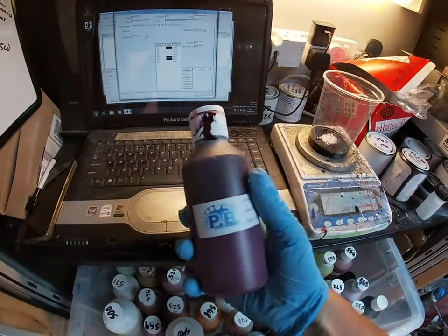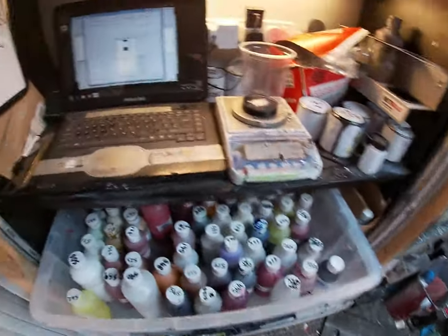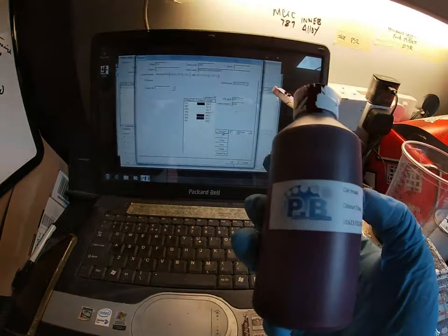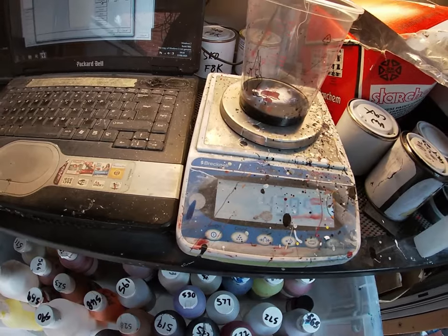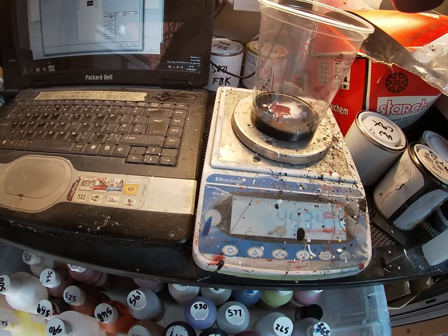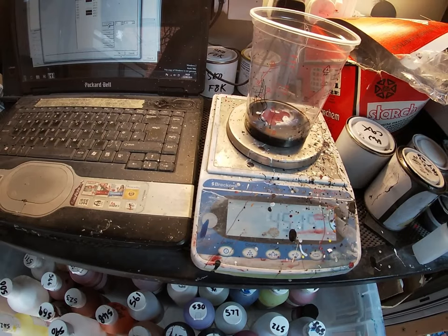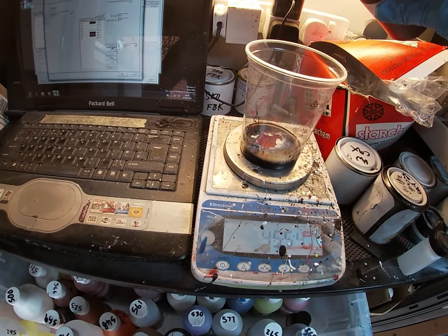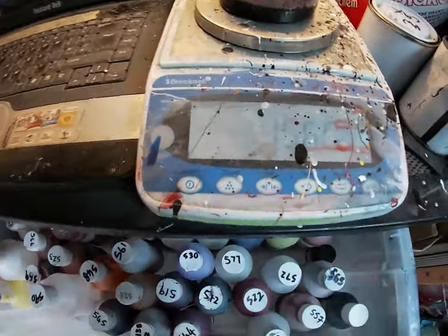Now 519, which is a bit of a purple tint — you wouldn't think it, but that blue car out there has obviously got a bit of purple in it. Target is 45.6. These last few tints, the values are getting less and less. We go from 45.4 to a little drop — that's dead on 45.6.